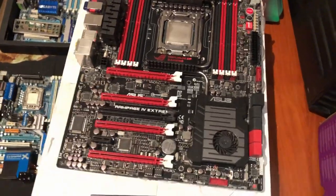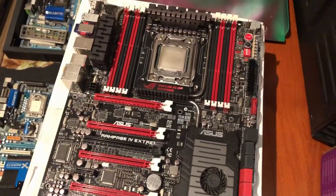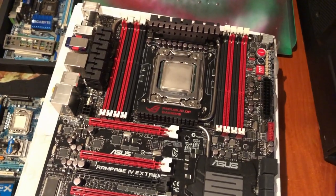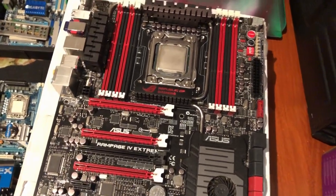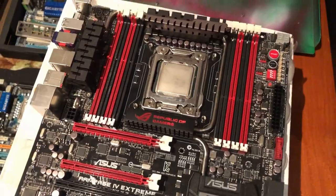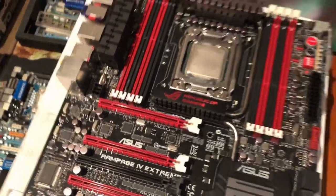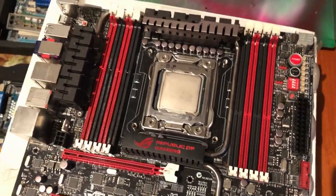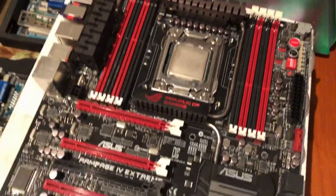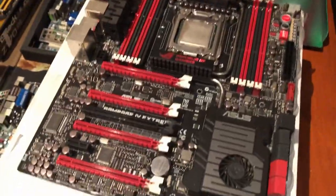This may very well be my favourite motherboard. You always have a fun motherboard when you get a good CPU or two to go with it and some nice memory. I've got some 2200 C7 PSC kits — two DIMM kits. Normally you should run a four DIMM matched kit in something like an X79 or X99, but these ones work perfectly — almost like they were made at the same time. Binned separately but dead on. The 3930K I had in this — I've posted HWBot scores of 5.3, 5.4 running Cinebench on chiller, positive temperatures.